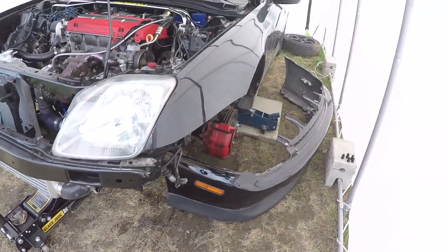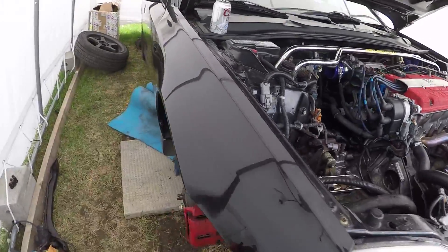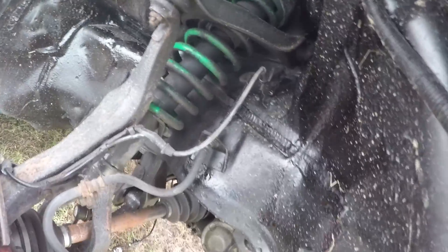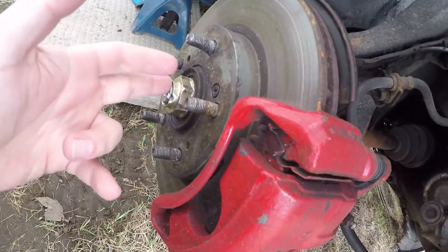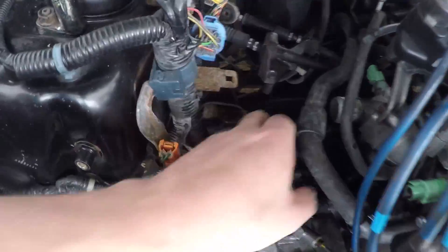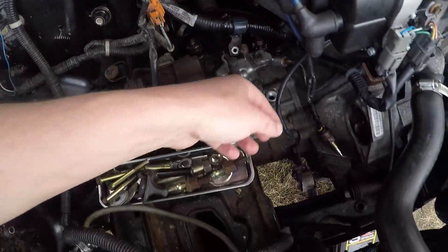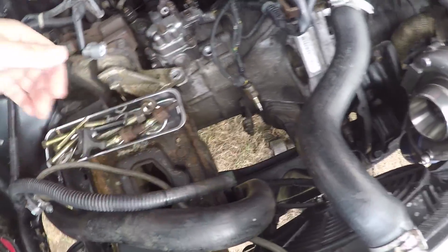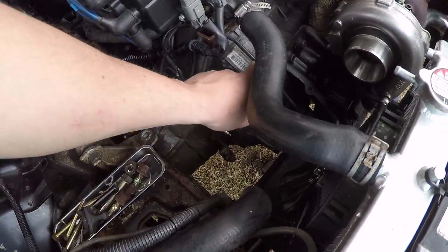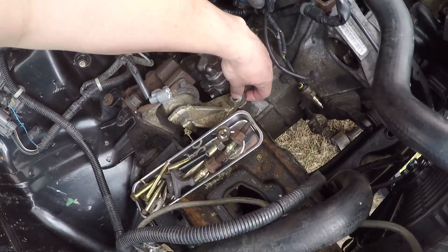Here's where I left off — everything is kind of disassembled. I noticed that I didn't have any 36 millimeter nuts to remove the axles on both sides, so I wasn't able to do that. I should be able to do it with the impact no problem. I unplugged the O2 sensor underneath because the exhaust will be redone and the factory cat will be removed. I started removing a whole bunch of wires — the clutch lines have been removed, sensors, grounds, powers, everything's kind of gone. I have not removed the bolts from the tranny but I have removed the mount from it.